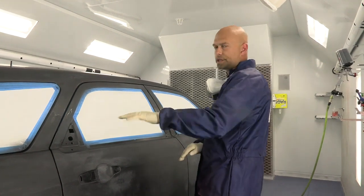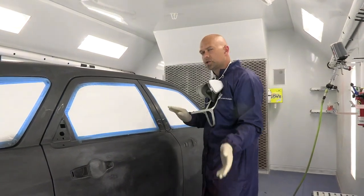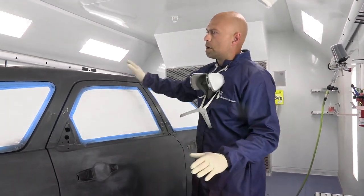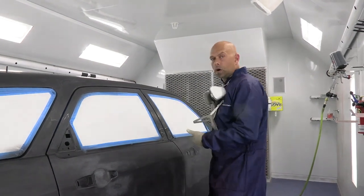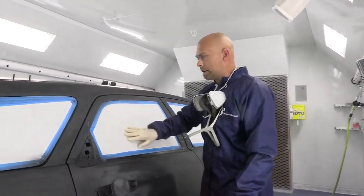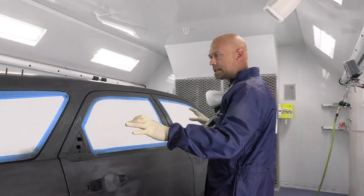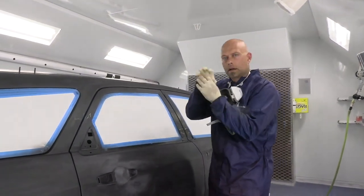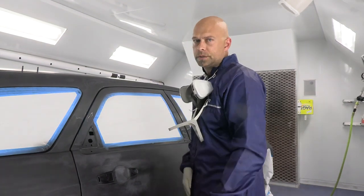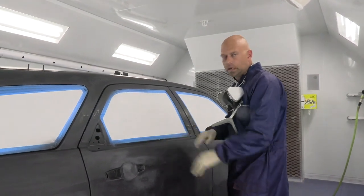PPG SX394 was the first step, and then I finished with SX320, which is their solvent-based — best of both worlds to make sure there's no contamination. SX320 is the weakest solvent pre-clean they have, kind of a pre-paint pre-cleaner. Went ahead, wiped it all down, tacked the car off quite a bit. When you're tacking, don't just tack off the surfaces you're going to paint — tack off everything around it: the masking paper, windows, any pockets, anywhere taped up. Keep everything nice and tight, with no creases in your paper that create little caves for dust to accumulate, or your spray gun will blow out some junk.